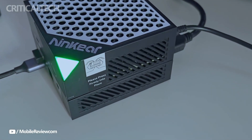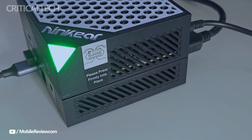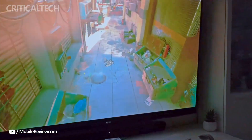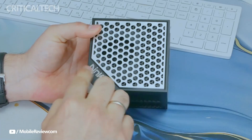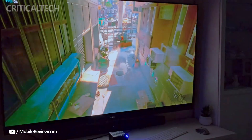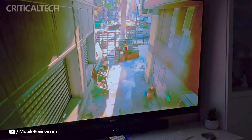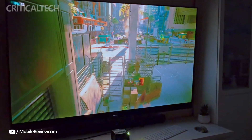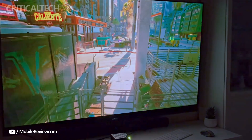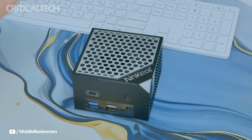One of the standout features of the M-Box 8 Pro is its modular two-part design. The main unit magnetically attaches to an expansion base, which significantly enhances connectivity options. The base includes two USB-A ports, HDMI 2.0, DisplayPort 1.2, a 3.5mm audio jack, and dual Ethernet ports. The main unit itself has a front-facing full-function USB-C port, a rear USB-C port, and a power button.